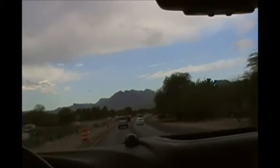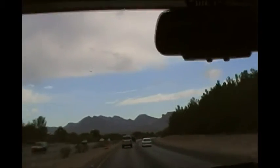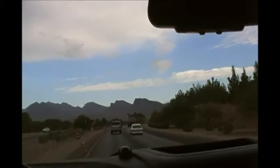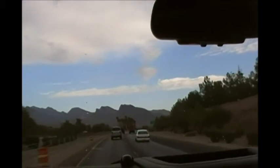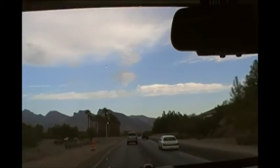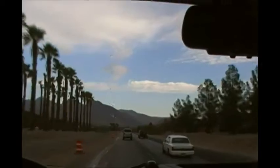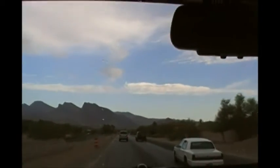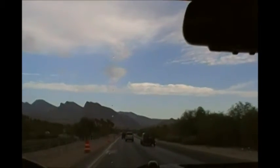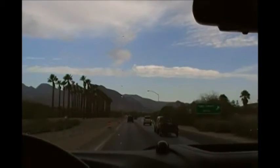This Jeep actually drives really good. I'm not sure what suspension he has on it, but that's something very important that you must consider. The last Jeep we did, the geometry was off big time. He had his track bar and his drag link about 4 or 5 inches separated. You hit a bump in that thing and it wanted to change lanes. So we ended up having to redo the geometry on the front suspension after the swap was done. And we do that quite a bit, actually.